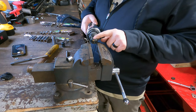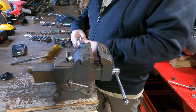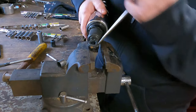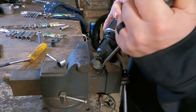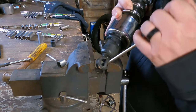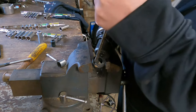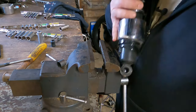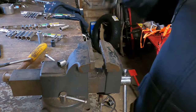From there we have to drive this little rubber bushing out. We should be able to take a flathead screwdriver, stick it in there and force it out. Work it around a little bit — make sure you break the rubber free of the steel shock eyelet, it's been in there a while. And now jam your pinky finger as you're doing it. Ow, did it again. Rubber eyelets are out.